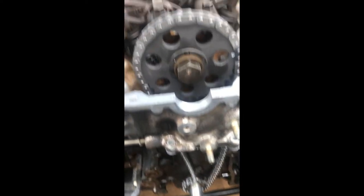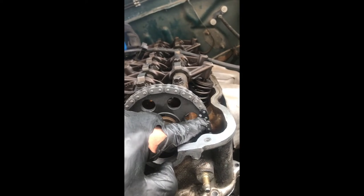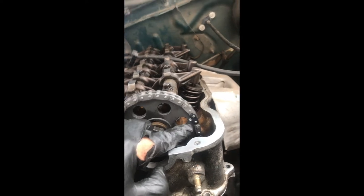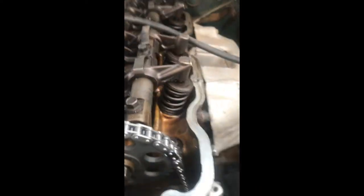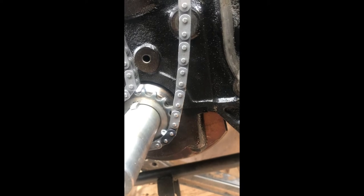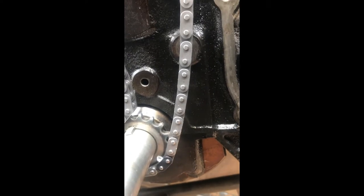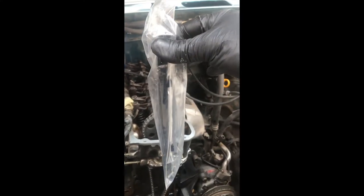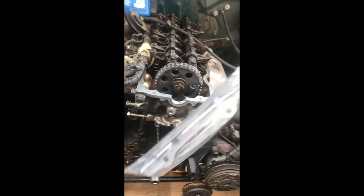I put the chain, dropped it down from the top to the other. The chain itself sometimes has different color links — black is common. Here's the mark, and this notch is aligned with the arrow. Then we come down to the crankshaft — they have the same thing. I put white paint so you can see it lined up with the black mark on the chain. The chain is just loose for now — preparing it. Next I'm gonna put the guides: the straight guide goes to the right and the curved one goes to the left.